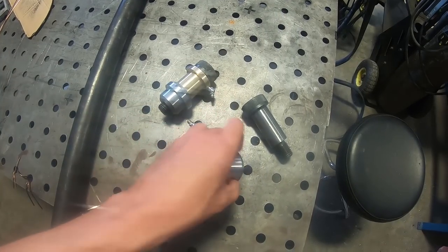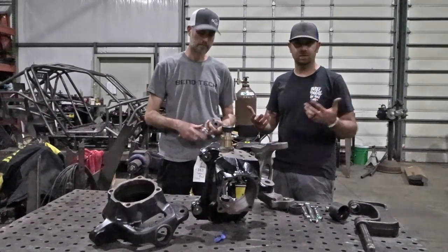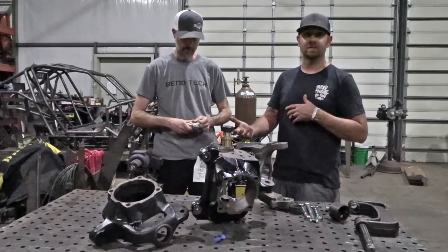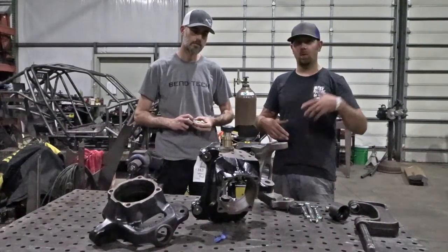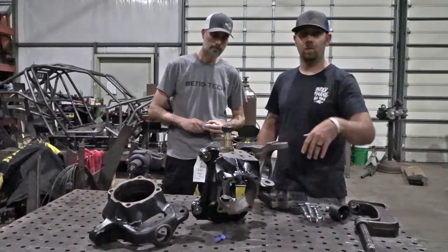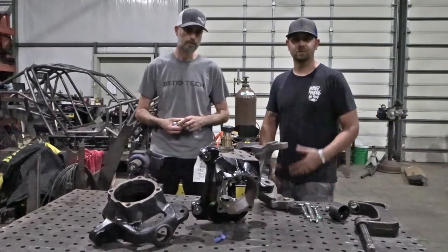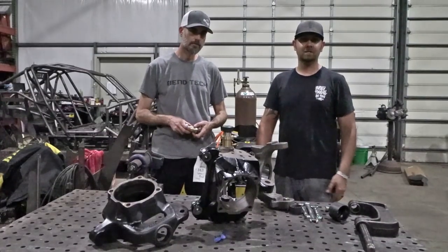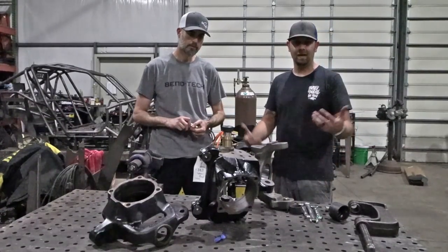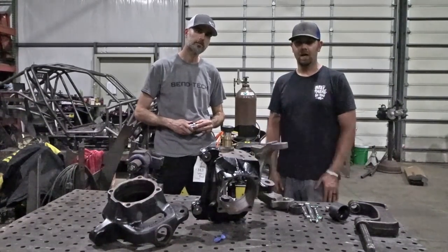That's it — it's gonna make your entire assembly a lot stronger and make your axle a whole lot better for off-road. There is always a trade-off though: this is gonna eliminate the possibility for camber and caster adjustments like you'd have on a standard ball joint. If you're driving on the road a lot and worried about tire wear, this might not be the product for you. But if you're the type who wants zero failures off-road, this is definitely for you. Think about old-school kingpin Dana 60s — none of those had camber and caster adjustments either, so it's really not a big deal.